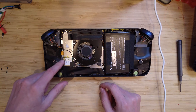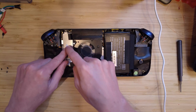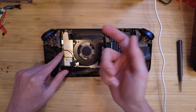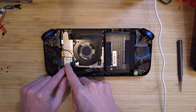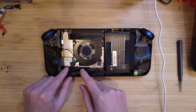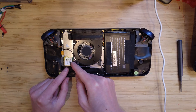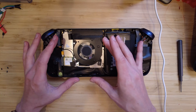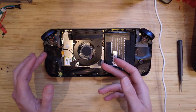I've just taken the tape off — I don't think it has to stay on there for any reason. There's a little double-sided tape cable guide I've just left off. You can remove the Wi-Fi card, but the antennas are quite small and delicate. What I did was just unscrew the Wi-Fi card, leave it off to the side, take everything apart slowly, and then put it back in without unplugging the antennas.